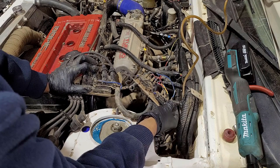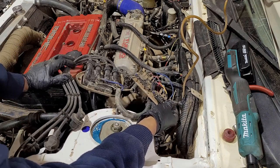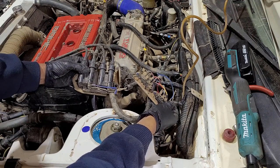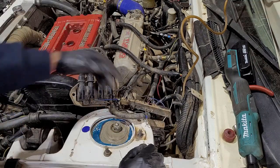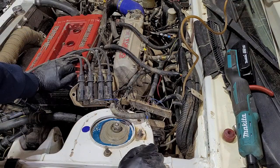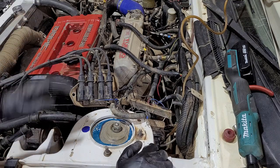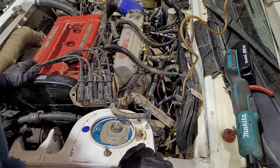This is basically a factory setup where they use two igniters that fire the coil packs. These are a wasted spark type coil pack by the looks of them. We're going to do away with all this. We need to label up some of these wires because we are going to have to work it out when we get inside, change the plugs, put a coil-on-plug setup on here, and that will alleviate some of these dramas.